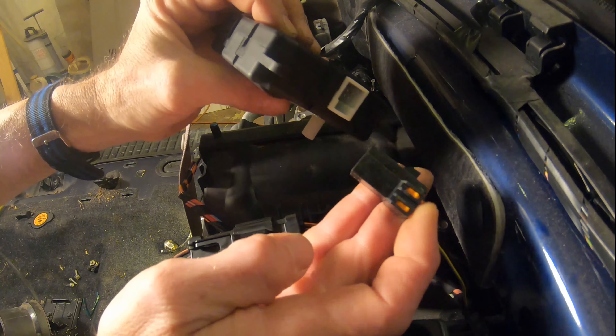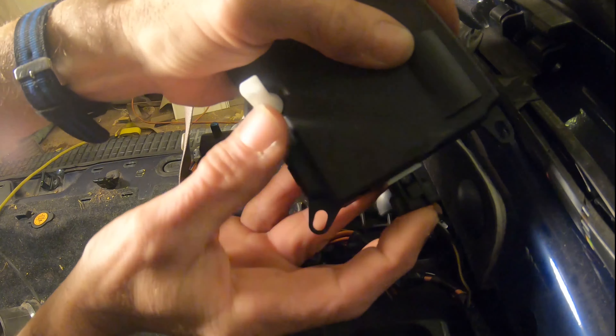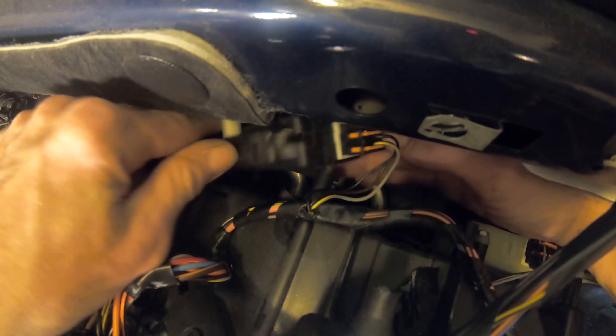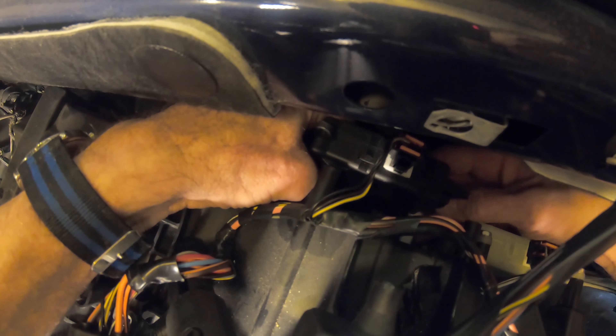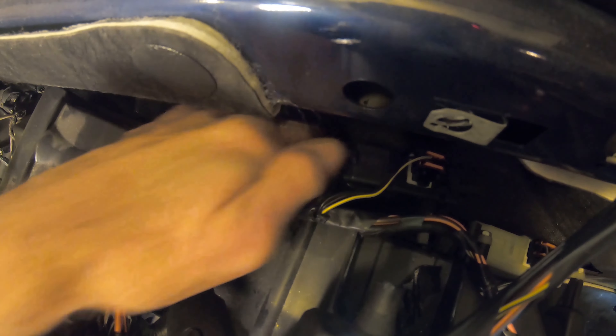I'll try to give the link in the description for the correct one if yours is the same problem. Now, plugging the wire in first just to make sure it fits into the new one. I want to try sitting it down with the wire in, but that isn't going to work. The problem with the wire connected is it doesn't give you enough leeway to start the shaft in the hole. So after a few failed attempts trying to start that into where it belongs in the heater box actuator, I'm going to take another round at it minus the wire. Once you get it started in the hole, it only goes one way — and there it goes, it pushes into place.